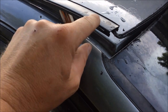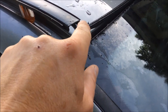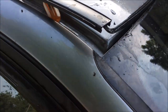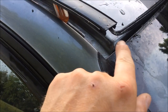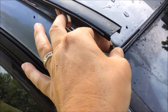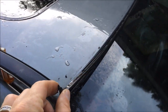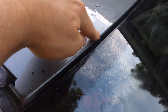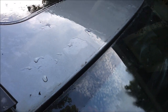Get the weather stripping out — I just popped this up and left it propped. To get the strip out, grab a pair of locking pliers, affix them on the end, and rotate it back. Be really careful not to break anything such as your windshield. When you rotate it back, the whole strip will come right out. Be sure to get all of this residue off so that we get a really nice tight fit with the new weather stripping.